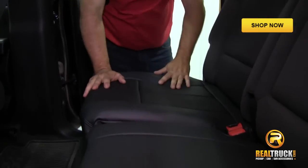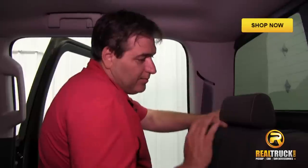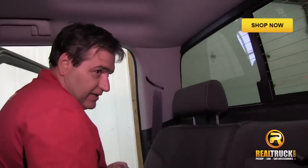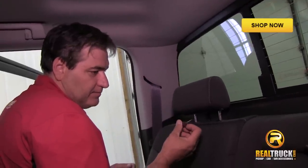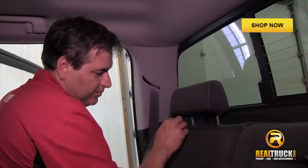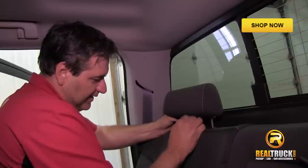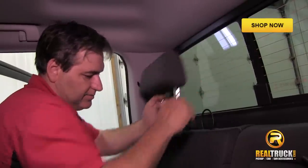That's the bottom on this side. We'll fold this back down, take a look. It looks just as nice as the other side. Before we put our seat backs on, one of the things we need to do is remove our headrest. It's really an easy process — all you need is a little pick or something like this. Right in the bottoms of the places where the headrests slide in, there are a couple of holes. You just push in on that, and that will allow the headrest to slide up and you can pull it right out.